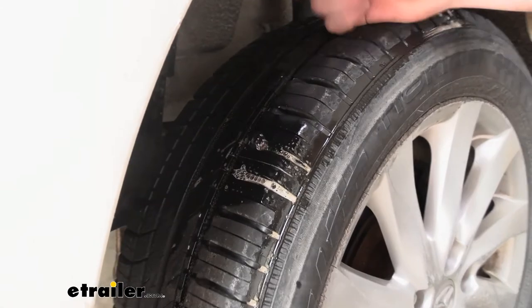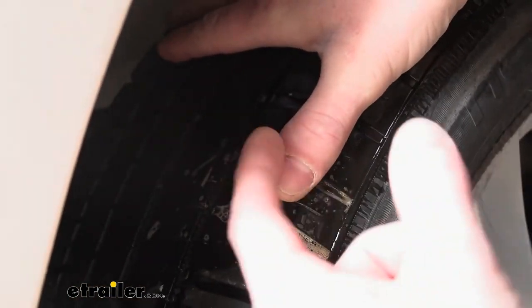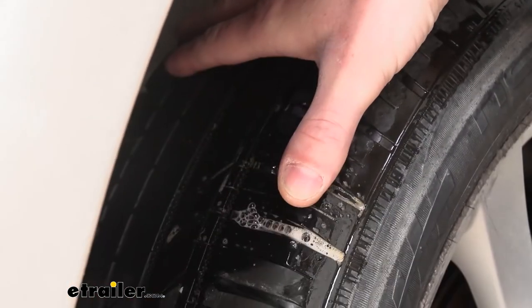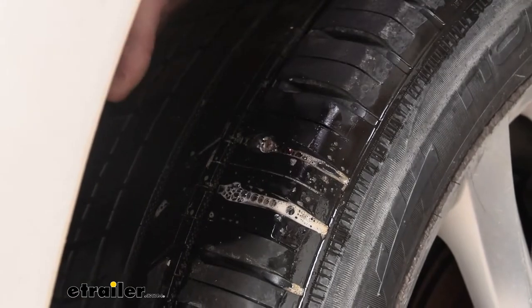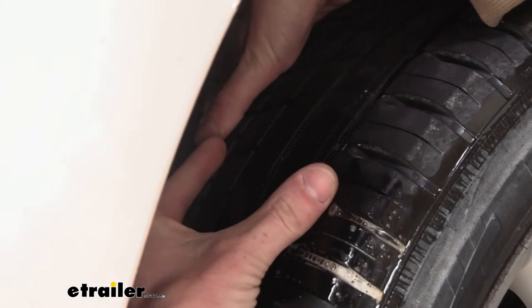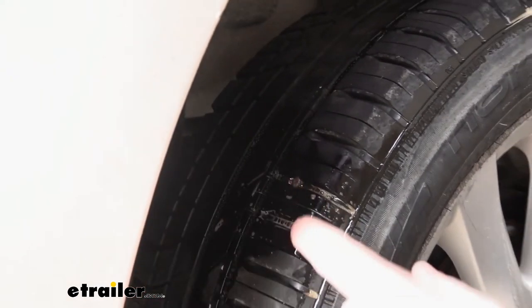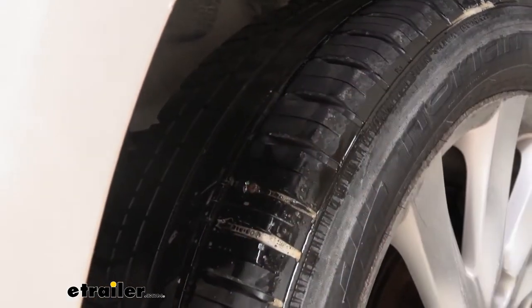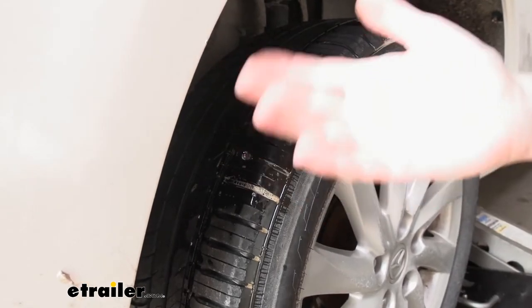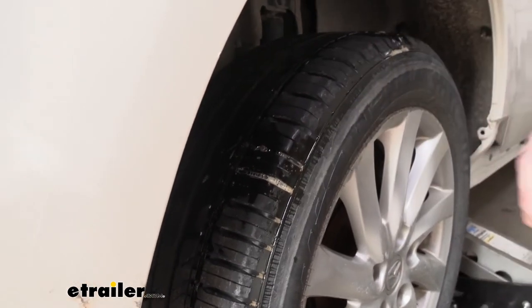I like to go by what's known as the rule of thumb — I just place my thumb on the edge of the tire. As long as your nail or leaking area is on the inside of your thumb, then you can repair it. It's the same with the other side of the tire: put your thumb on the other edge, and as long as you're on the inside of your thumb, that area is all repairable. If it's too close to the sidewall, you start to get flex there, the plug can come out, and you'll have a leak that's even worse than your original one.